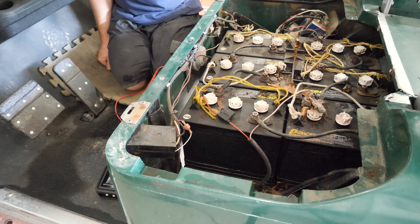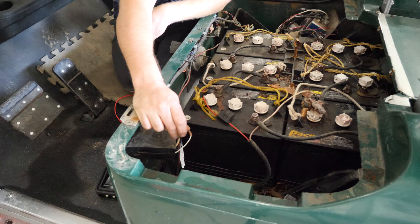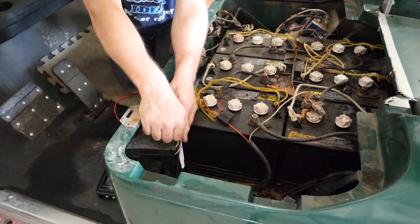There's a reed switch inside that charge socket. Basically, when you plug the charger in, there's a little magnet and it opens the reed switch, disconnecting the positive power from this wire here and not allowing the controller to turn on. It basically deactivates the solenoid.